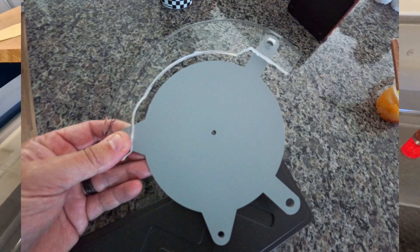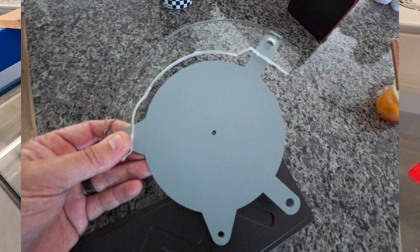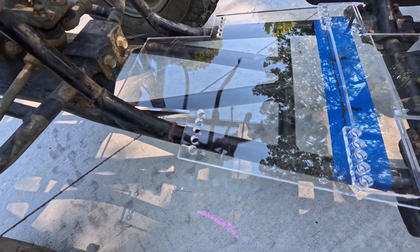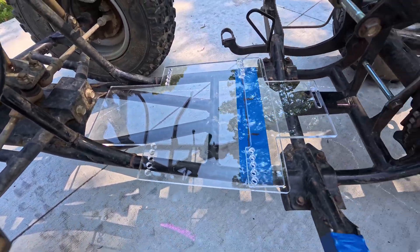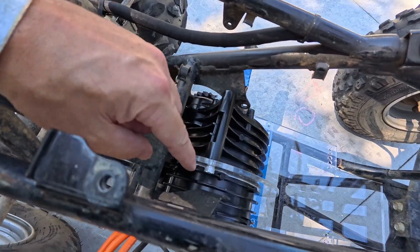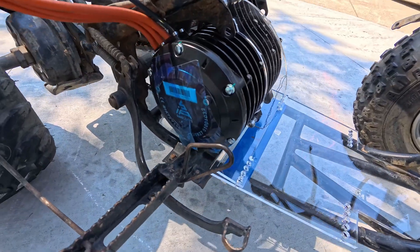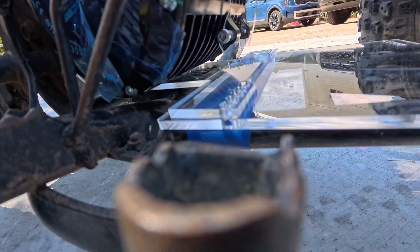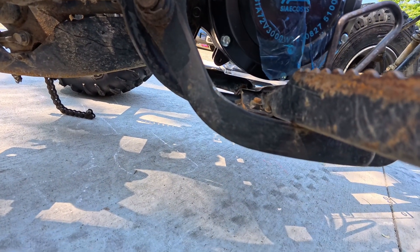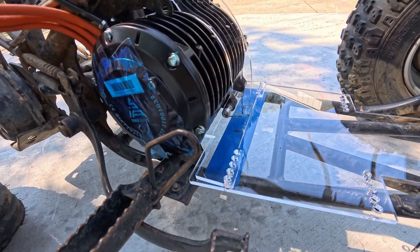As you can see here, I did have to Dremel a little bit just because it's again a rough draft. I went ahead and cut a two-piece system into the floorboard — it basically allows me to space the motor up and mount to that bottom bolt hole while keeping the battery on a completely different plane, about a quarter inch lower, so this works out really, really well. I might weld this in time, but I put these holes in just for U-bolts so I can template it and keep everything straight. When the motor's mounted, you can see I can't actually use the top bolt hole, which is what these brackets are for — it allows me to tie those top mount bolts into this lower section. There is obviously a gap here, but I'm going to fix that up in future iterations. That just gives me a rough idea to template everything. Really, really happy with how this is going.